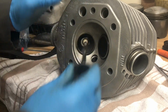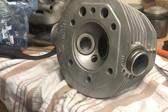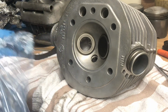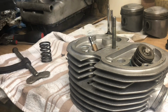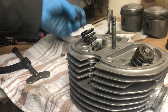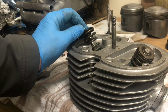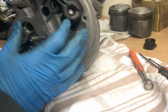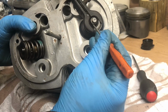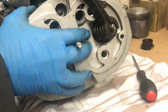Valve greased carefully into the valve guide, like so. Unbag the parts for the left-hand exhaust valve. Okay, valves inserted. So first off, the spring seat, the spring, the top piece, which is the retainer, and then compress. Okay, compress the spring, drop in your spacers, and decompress the spring.